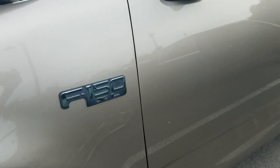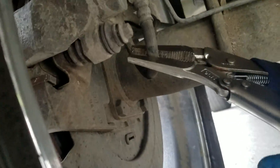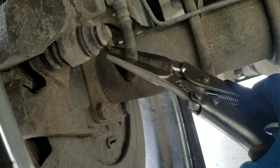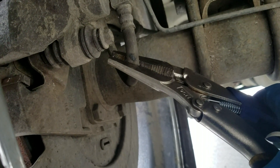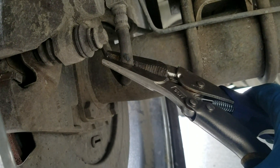We're going to go to each wheel and at the same time put a vice grip pliers over each wheel like this, which I already did. We plug this one and redo the test while this one is plugged in — press on the brake pedal, and if anything changes we'd be concerned about replacing that part. However, I already did this on all four wheels and nothing happened, so the situation is still there.